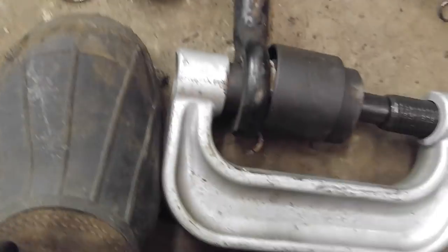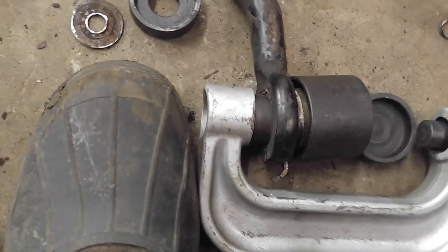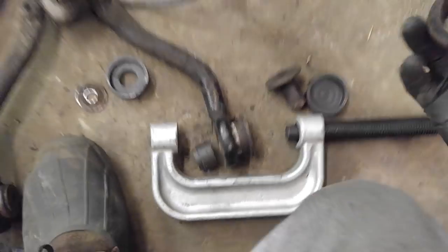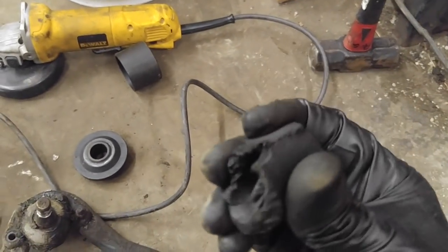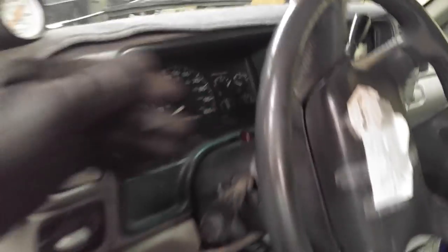Isn't that moving? I may have bottomed. Yep. There goes the sleeve. Can you believe they sent out this? This bushing was going bad 3 or 4 years ago before we split up. And I told her, change your steering box, put in a good used steering column that's not sloppy. I'll show you what I mean with my greasy paws. Check this out.